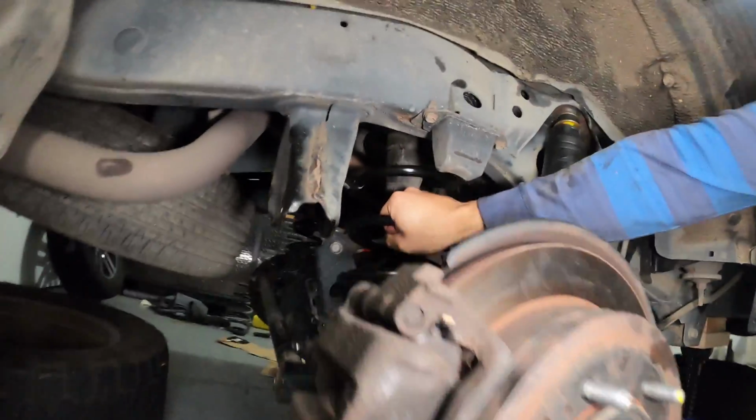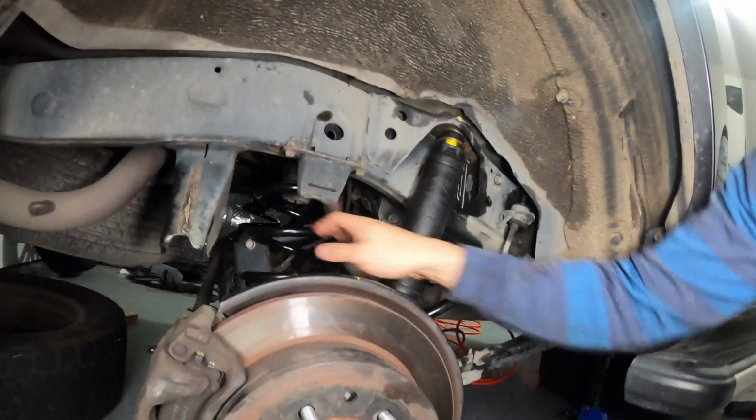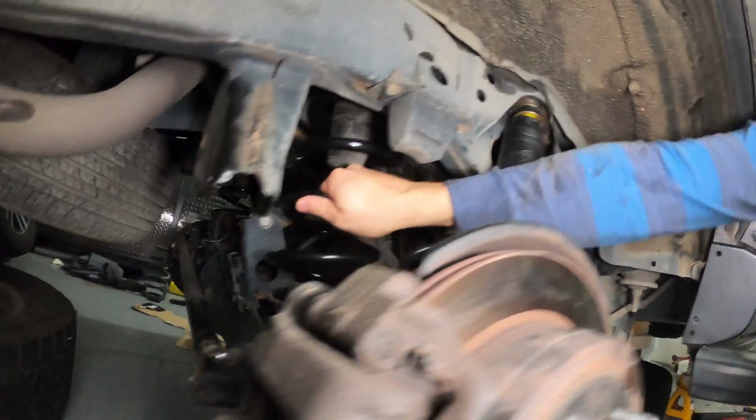All right, so I got my shocks on here. We got our coils in. So our shocks have been put in on both sides. We got our coils in, they're properly seated. We've tightened everything up to torque spec. I'll put the torque specs in the description of the video. I've gone around the car now and I've just rechecked all the torque settings on the front. The last part I have to do now is just put the skid plate in on the front there, put the wheels back on.